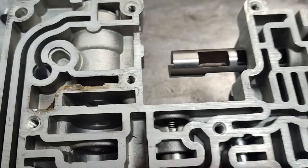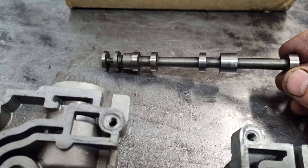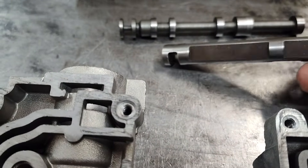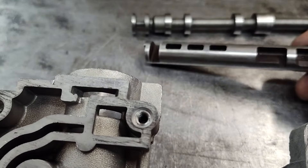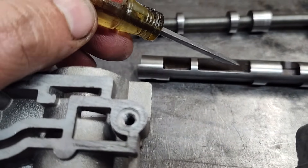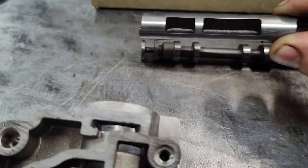So this here is what's called a spool valve. It's perfectly round, so oil pressure is balanced on all sides — this one is out of a C4, and that's typical of a lot of valve bodies. But then you have a C6: it's still round, but you see these slots machined into it. What happens is, depending on what gear you're in, you may have oil in this area, and what this does is side-load the valve — you'll have pressure on one side, it forces the valve up against the bore, and it makes it harder to slide.